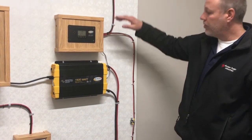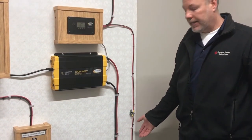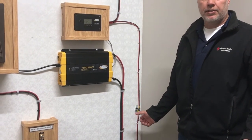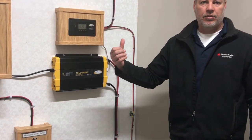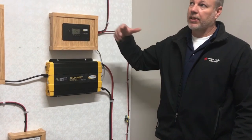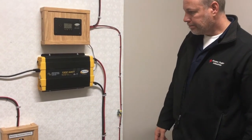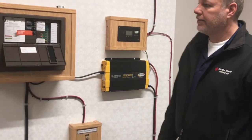Same thing with the solar — it's always charging. There is no shut-off for the solar panel; it's always charging, but don't rely on it over the winter. If it snows and covers that, your parasitic draws are going to overcome the battery. Or if you put a cover on the trailer or put it in your garage, always make sure you shut the disconnect off. That's the 12 volt side of it.